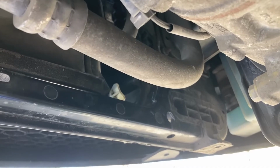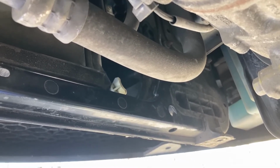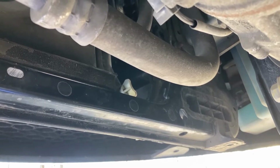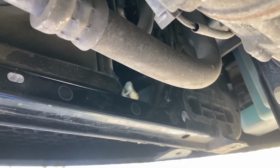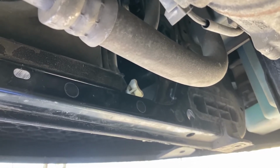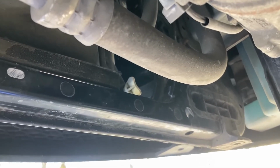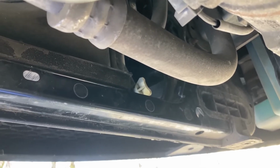Here I am underneath the car again for the final drain. And one important thing that I forgot to mention with the earlier computation is that it only works if the coolant and water mix is 100% homogeneous. That's why it was so important for me to actually drive the car after each top up with water, because we need to be certain that the concentration of antifreeze is the same in the volume we have drained as well as in what's left inside the rest of the car.